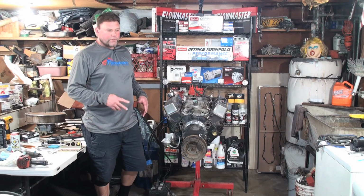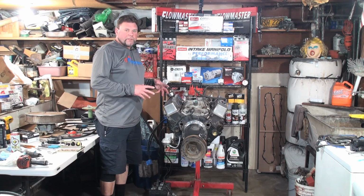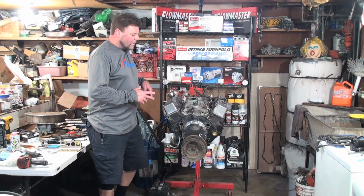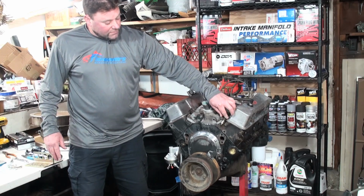Like I said in the beginning of the video, I had an issue with the starter. We're gonna check the starter, make sure the starter works, and kick over the engine, see if the shims are working right. Hopefully we don't gotta mess with the shims or nothing. I also got the number 1 spark plug hooked up, and I'm grounding it to the block right here. And we'll see if we got spark.